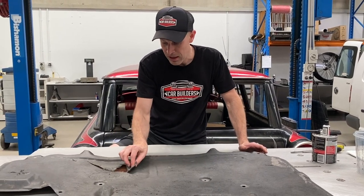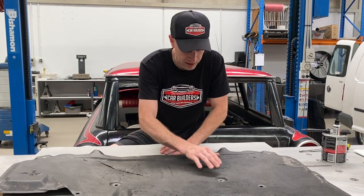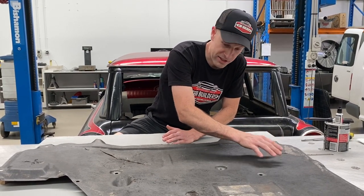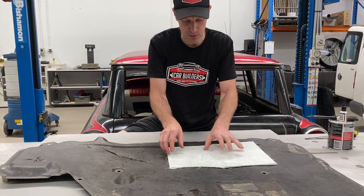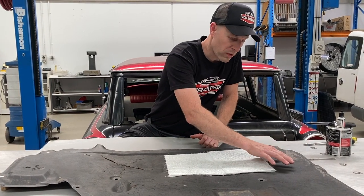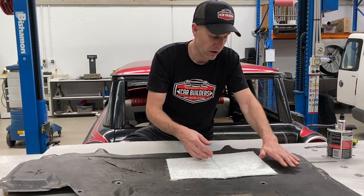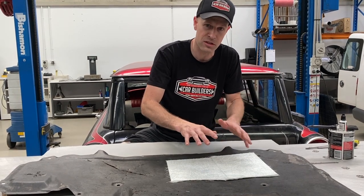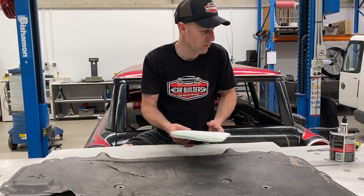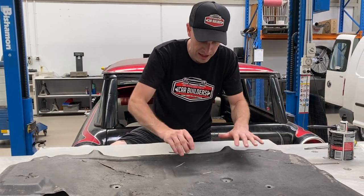You can see here I've cut away and relieved the tension where that fibrous material has come unstuck. The reason I'm doing that is, in a couple of these areas you can see it's bridging - it's not going to have a structural face. We can put some chop strand mat - just some fiberglass chop strand mat - to patch repair areas where structurally it's not there. Otherwise if we just pour resin in, it could stretch and bleed down, or if you press too hard you could crack it. So we've got the option to put some glass down to give it structure. I'm going to cut anywhere it's bridged and let the material relax.